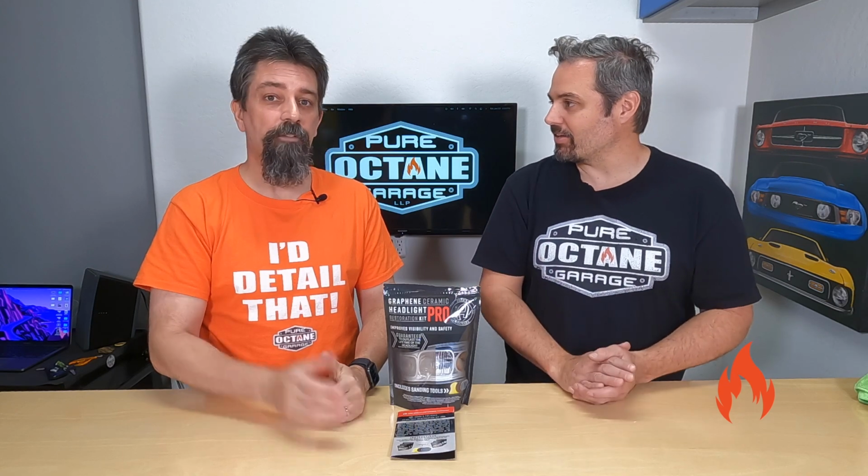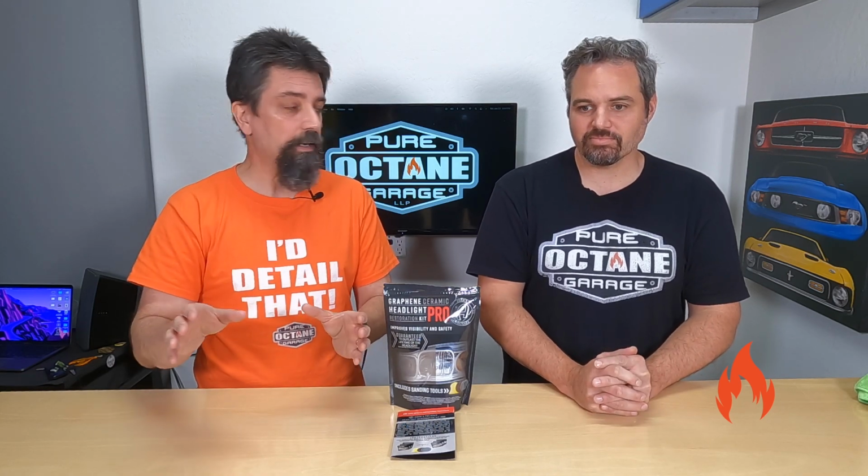So luckily, your headlights are not very big on that vehicle. Very small, so we opened up the second pouch, which was fine. It was clear. Again, use these kits in a well-ventilated area. Oh, it stinks. Quite an odor to it. I mean, that's normal. Nothing wrong with it. And make sure you got your gloves on for that final step as well, the second set of gloves.